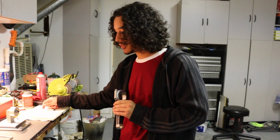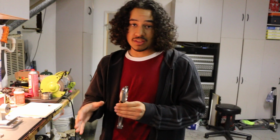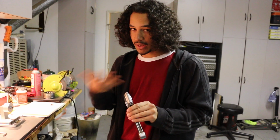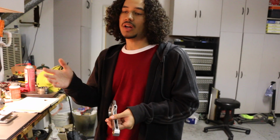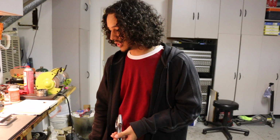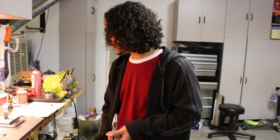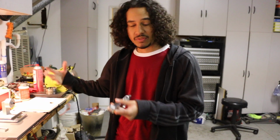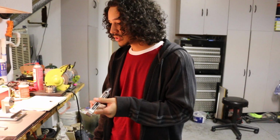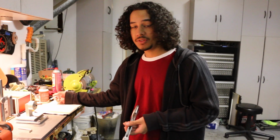Now with this, considering it is very difficult to get repeatable measurements, I'm just going to be going by a tenth of a gram, which is satisfactory in my terms, because it's going to be very difficult to balance everything out to the hundredth of a gram or thousandth of a gram. It's very frustrating. So I'm going to start by removing material from rods 1, 3, and 4, and I'll catch up with you guys when I've started working towards that. I'll probably do some off camera just to get an idea of what I'm doing, because this is my first time doing this. So I'll get back to you guys when I'm ready to update you.